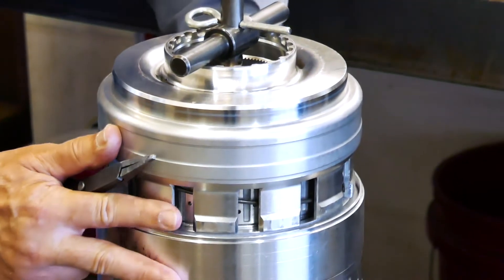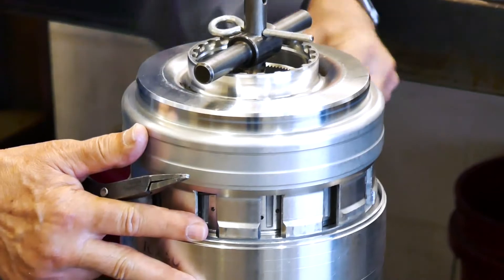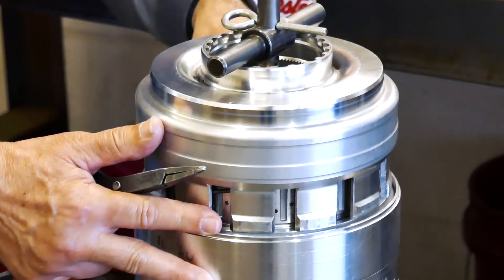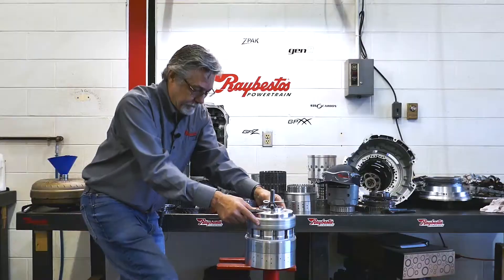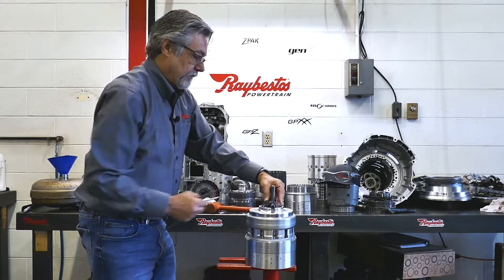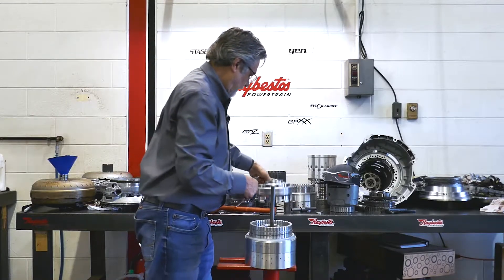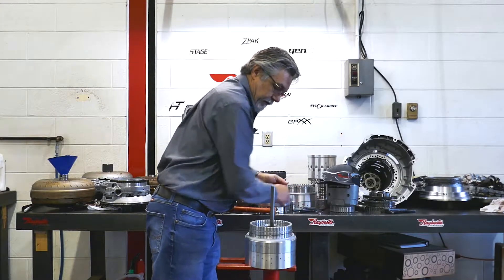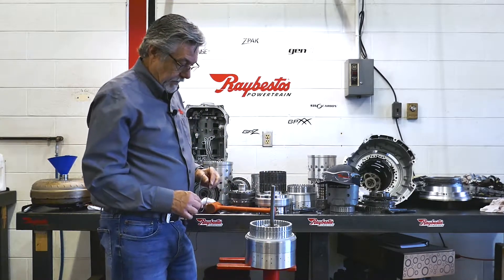You might also have to move your piston around a little bit. I'm just pushing up on the snap ring now — it's out of the groove. So I can release the foot press, pull that off, and there's my snap ring. Easy as that.